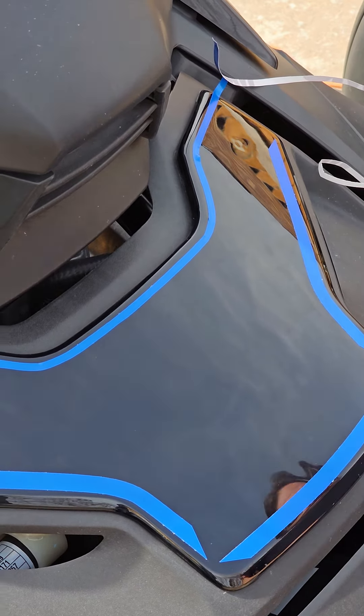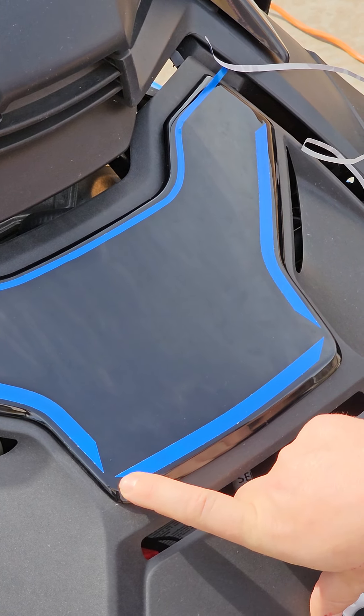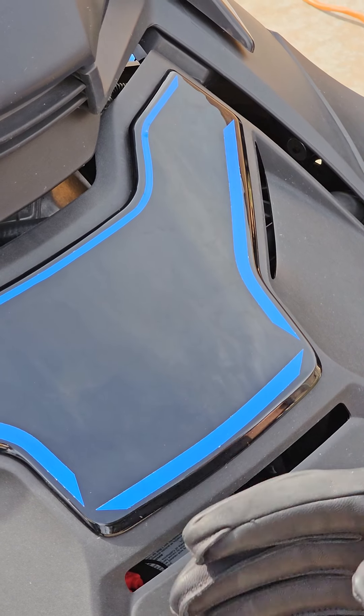As you can see, I'm pulling up and pushing down. I've still got to bring it down a little bit more. This corner didn't go exactly like I was planning, so I'm probably going to redo it — some corners just do not bend to that angle. You want to keep your eye on your line; if you start an eighth of an inch from the top of the curve, keep that consistent. Here's the second curve, and I'm working and pulling. If you look closely, I've got some small bubbles right there — that's fine, that's what the heat gun or hairdryer is for.